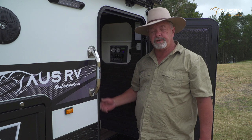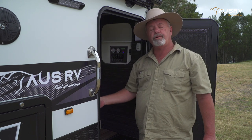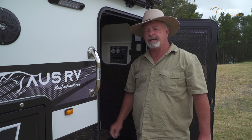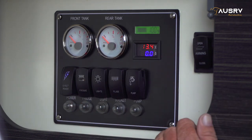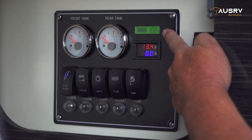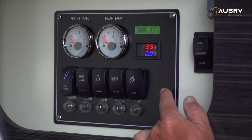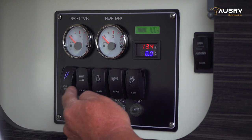The main electrical switchboard is just inside the door behind the cabinet. All the switches you need to control the various circuits are right here. The only other things you need to know are the monitor station for the BMS unit and the isolation switch for the 12 volt in the cabinet behind the seating area. The main components on the switchboard are the water tank levels at the top, your battery condition, voltage and how many amps you're using at any time. The next row is your circuit switches — on the left is the main switch, and with that switched off it cuts all power to the rest of the circuits.